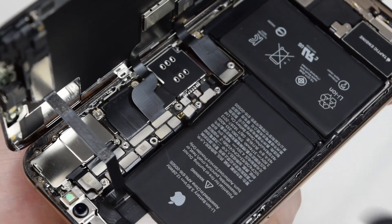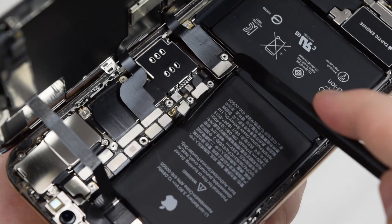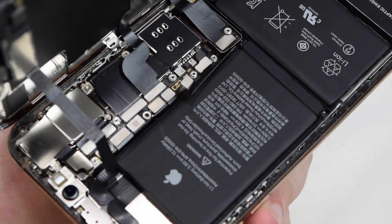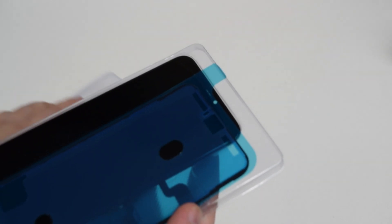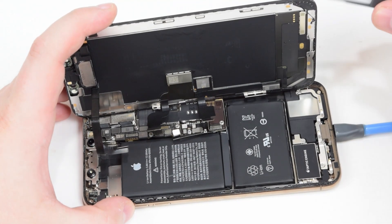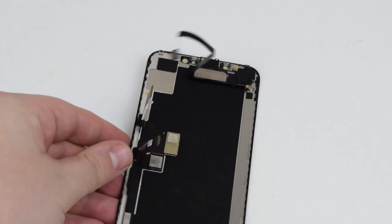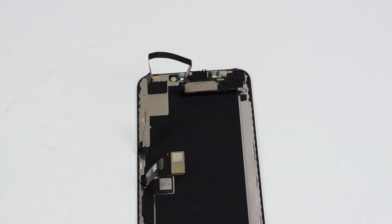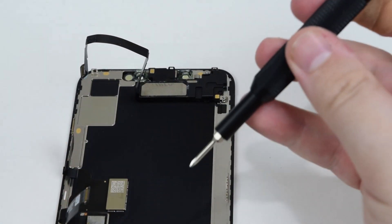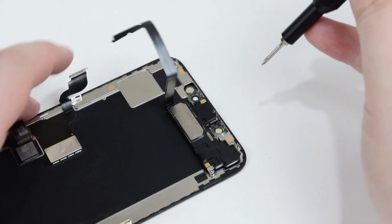As always, the most important part is disconnecting the battery. Taking a look at the screen I got in the mail, it is an aftermarket but very high quality screen replacement. If you guys are looking for any type of screen, parts, or accessories, take a look down in the description below. While taking the phone apart, I did get a little bit injured — it's going to be censored because I don't want to get in trouble by YouTube. Now once we have the entire screen assembly off of the housing, we're going to start at the ear speaker module at the very top of the screen. There are only three screws, and this is what I love about the iPhone X models — if you're careful, they're incredibly easy to repair. There's no home button, none of that annoying stuff that's going to break instantly. The only thing we have to worry about is obviously the top speaker and Face ID module.